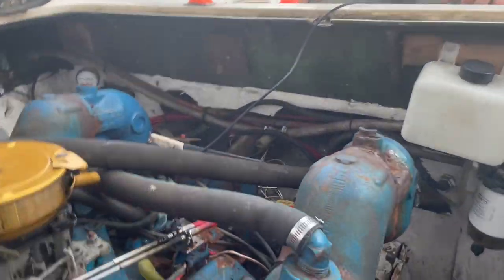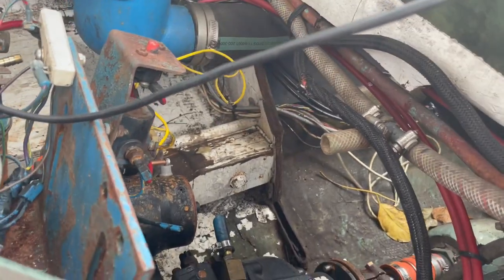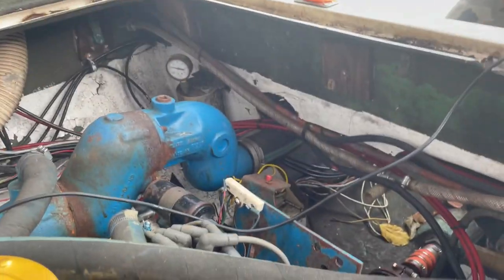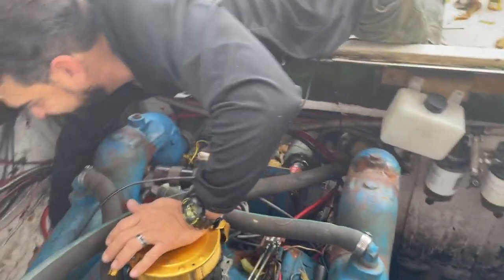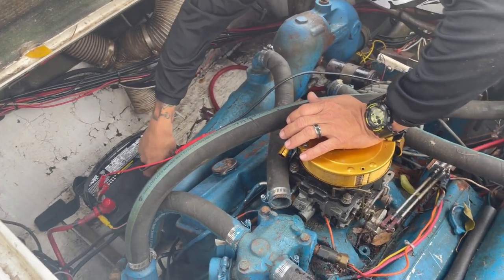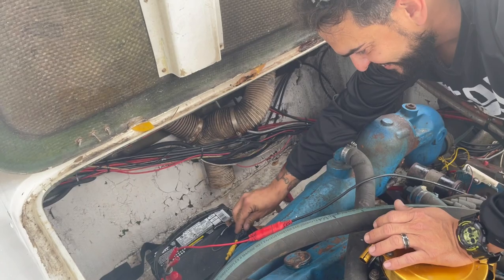All right Josue, so you just hit the starting solenoid here. It was hidden and it was stuck in the open position. I stuck it in the closed position and just kept spinning the motor. So if I get a new one we're fine - that was the only problem. Yeah, it's fine. The only thing you need is that. You're the man dude - you got that figured out real quick. That was less than ten minutes, like six or seven minutes. Nice job.